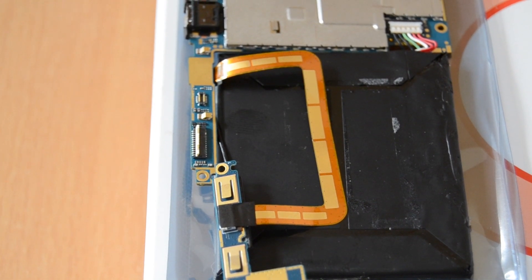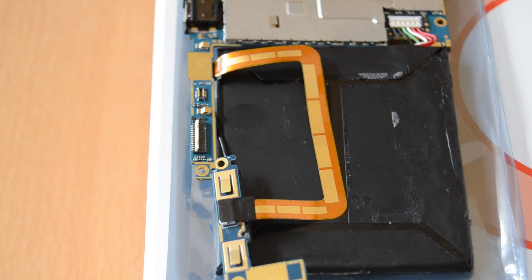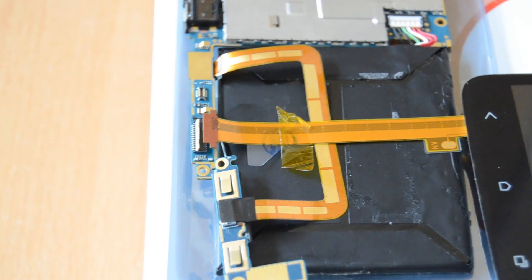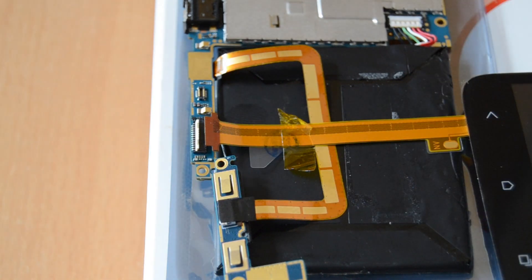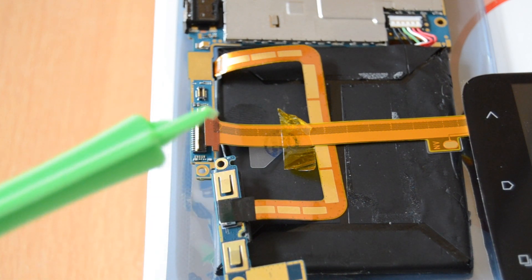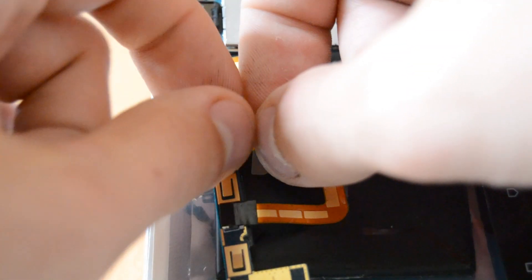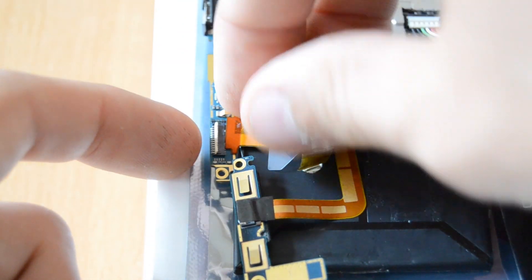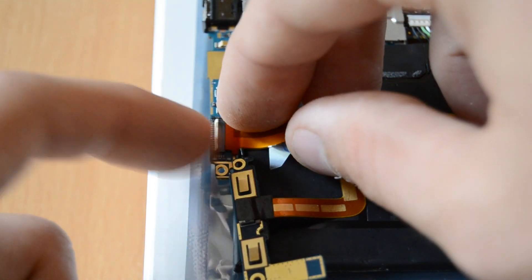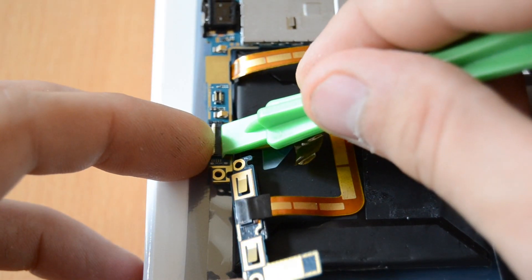First I want to show you a little test of the replacement screen. Here's the screen connector and all I have to do is attach the display to the mainboard and then power it on to see if the display is working. Here's the connector and here comes the cable from the LCD display. This is a little bit tricky — first you have to open up this little bar, just push it up, then push the connector in and make sure it's 100% in. If it's not fully in, even slightly out, your display won't turn on. You can use the pry tool that comes with the display to slide it in.